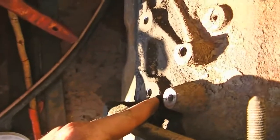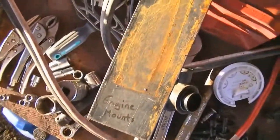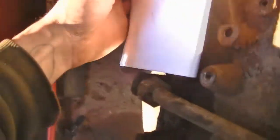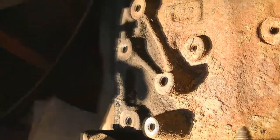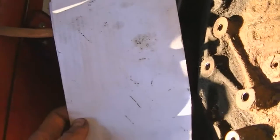So I'm gonna have to use — maybe I'll weld a couple washers onto the motor mount plate, and just leave that one flat so it'll be flat. To get the bolt pattern, I'm gonna get a piece of paper and put a bit of grease on that and then very carefully press it onto it, and that should give me the pattern.